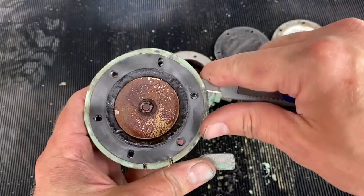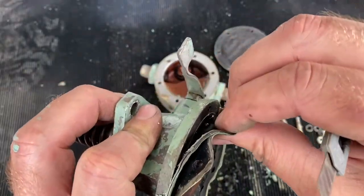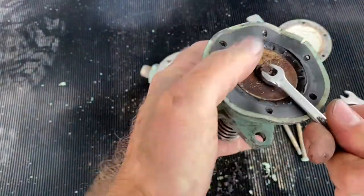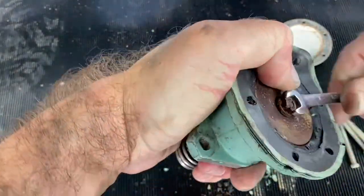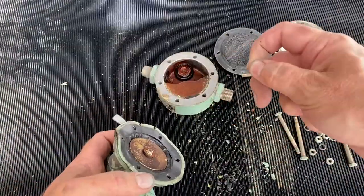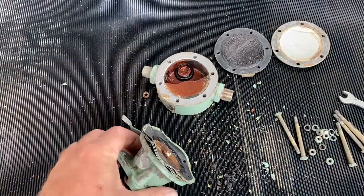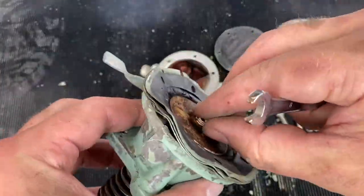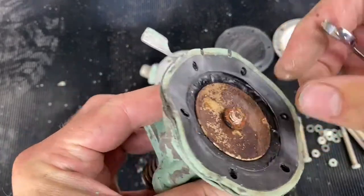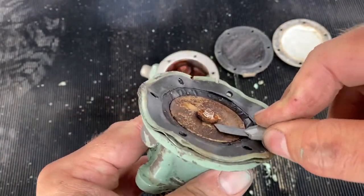These are a nylon fabric diaphragm coated in rubber. When I refit diaphragms I think I'm going to make some out of a modern nitrile material, and maybe even add another diaphragm out of some other material that'll be a bit more resistant to modern ethanol-containing fuels.